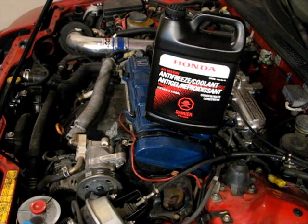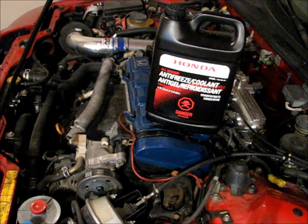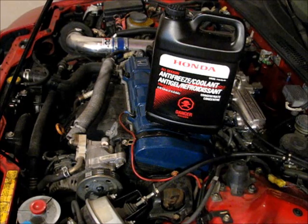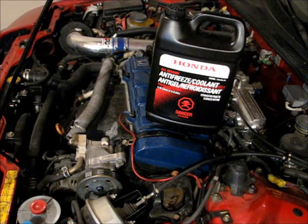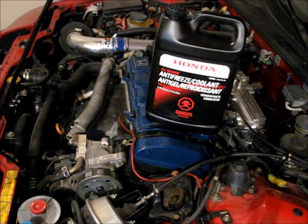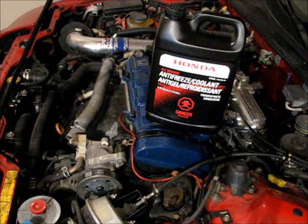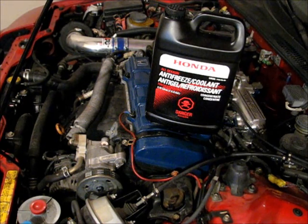The coolant that I use is right from Honda. I believe they call it Type 1. A lot of the coolants that are available at the auto parts shops, or off the shelf at your local hardware store, often include a lot of chemicals for inhibiting rust and things like that. Honda suggests that those types of products not be used in these cars because they have all aluminum blocks, and a lot of the components are aluminum as well, so a lot of the rust inhibitive chemical isn't actually required, and can just end up gooing things up instead. That's not to say that any antifreeze probably wouldn't be okay, it's just I tend to go with what Honda recommends to keep the engine in as good a condition as I can.